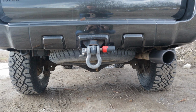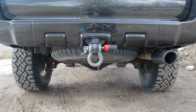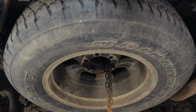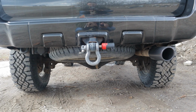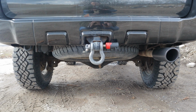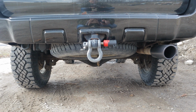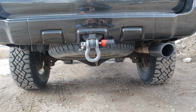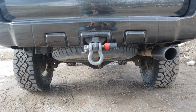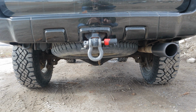But before we took this thing across the country with a camper trailer, I decided I gotta have some kind of a spare tire. So I ended up doing a 255/70/18 off of a Jeep Wrangler. It's just a factory size from the Jeep Wrangler, so you can find those used all over the place pretty cheap. And so I mounted that on the factory 18-inch Limited wheel, and the overall diameter is pretty darn close. It's close enough that it shouldn't cause any trouble with the four-wheel drive system. I still wouldn't be driving around on it for fun, but it will keep me from getting stranded out in the middle of nowhere and get me to a tire shop or something if I had to.